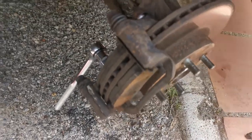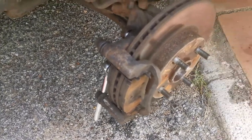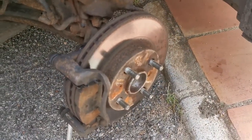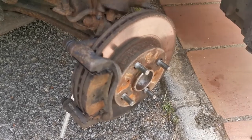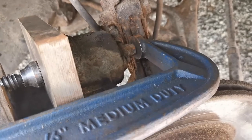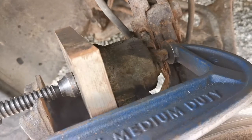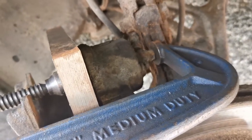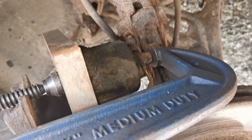I'm going to remove those and then slide this out so I can exchange the rotor or brake discs and replace the pads. I'm just retracting the brake cylinder to make it easier when I get the thicker pads on. I've got a G-clamp and a block - put the block across the front with the cylinder and just push it in, it goes in quite easily.